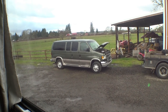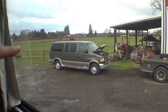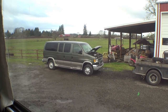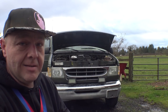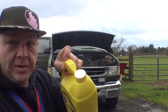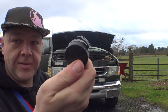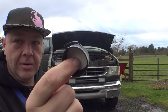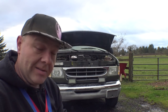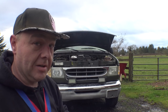It appears to be the next morning and it's time to see if our glue in a bottle worked. Got to close the drain plug, fill it back up with coolant, and then in theory we're done. Random life hack with jugs of coolant — you know how these have that little foil seal that's impossible to remove? Well, on these child safety lids there's a little edge you can use to cut the foil — you just go like that and now it's open. Pick the bits of foil out so it doesn't get into your engine.